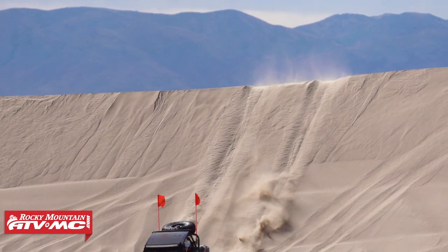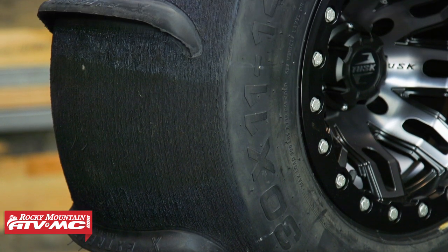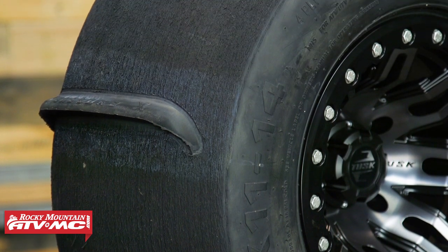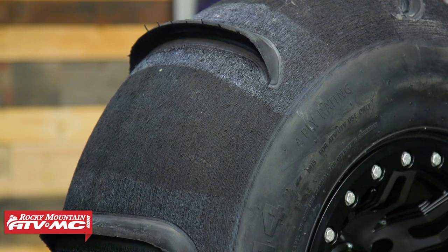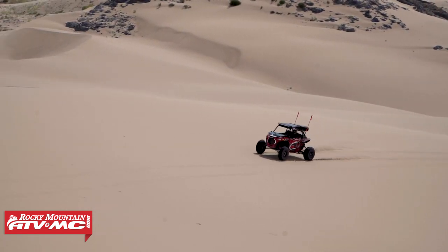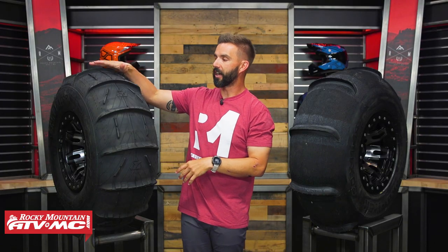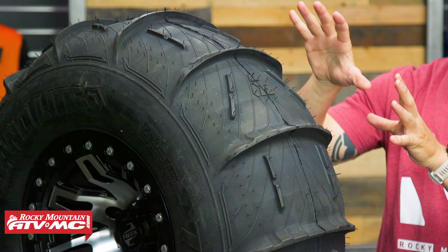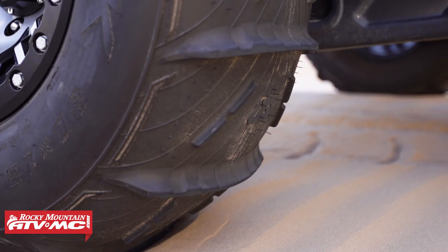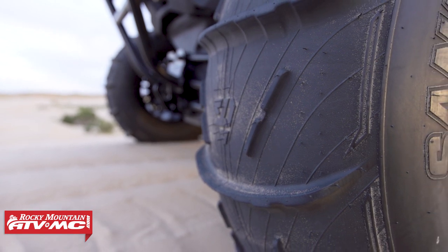Now let's talk about paddle design. With buff tires it's straightforward — you've got your paddles with completely smooth sections in between. With the Scat Track Extreme Grips, there are fewer paddles available in 8, 9, and 10 paddle options, but the paddles are taller so they really dig into the sand and give great forward drive — great for high speeds, drag racing, or hill climbing. With molded tires like the Sand Light, you have 14 paddles with center ribs in between. Those ribs help smooth out the ride on harder surfaces and help prevent your machine from sliding out on steeper hillsides. Molded tires are a great all-around option for a variety of conditions.